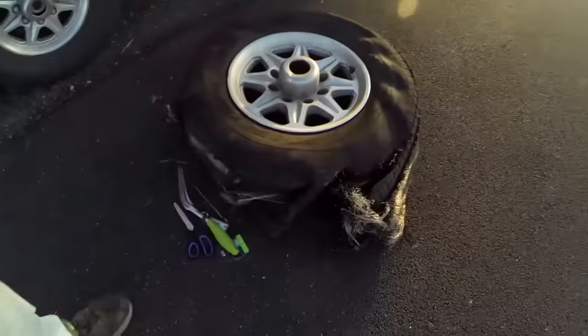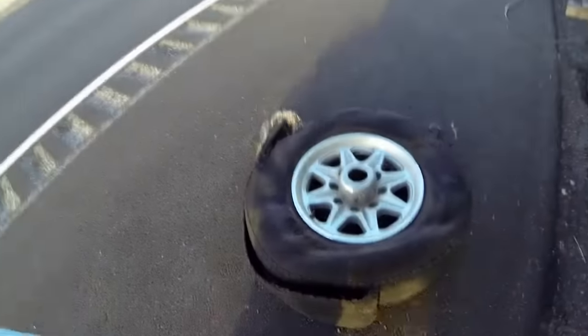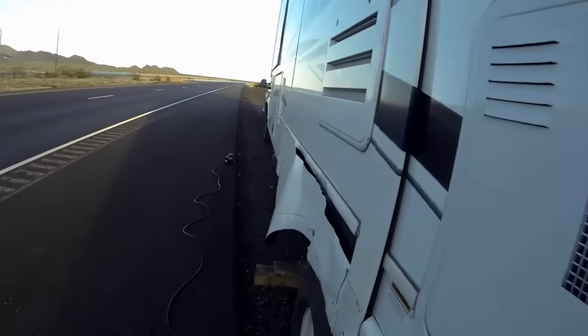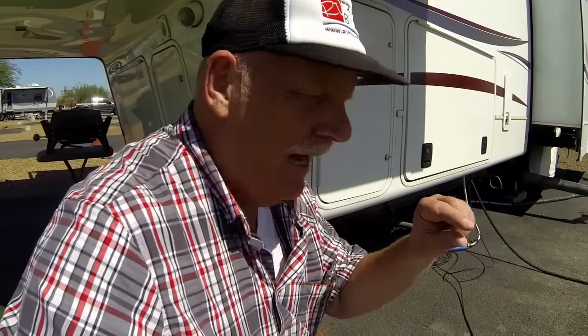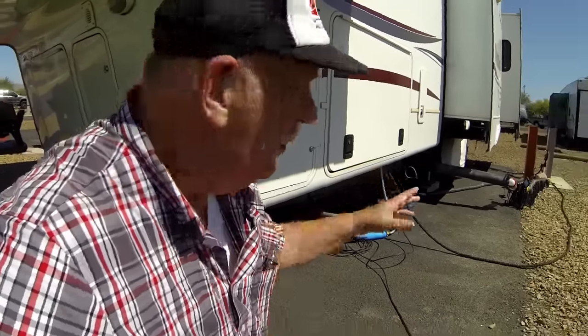The other thing you probably didn't see in that video — and I'll show you some clips — is that since the tire was flat, it was easy to take off. But to put the new tire on, because we only had a little space, we ended up digging a hole in the ground to allow space for the new tire. That's also why you heard us running a compressor — we let the air out of the spare to give us as much room as possible to put the new tire on while stranded.